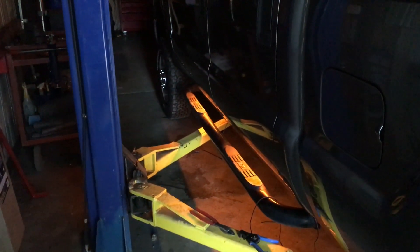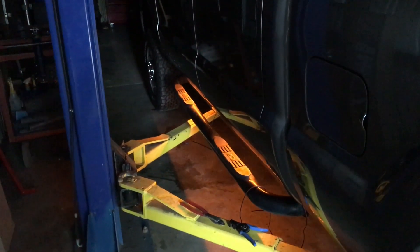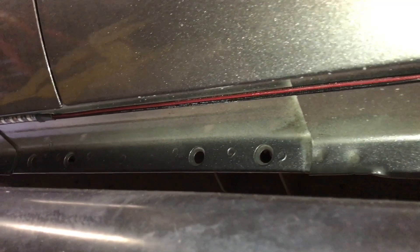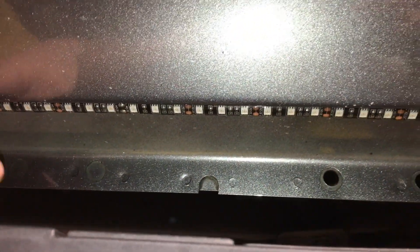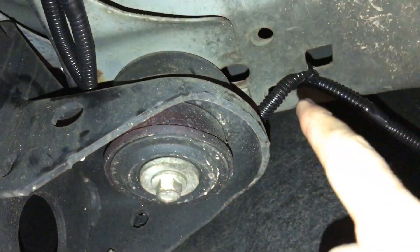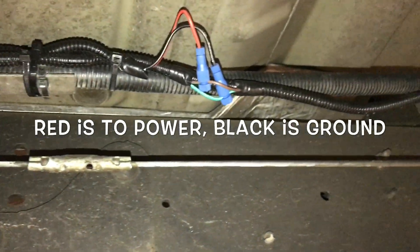There's a little back piece that you peel off and they're on there. Here is how I installed the LED strips — they have that 3M tape on the back, good stuff. I just ran them up under there. It's got a little splice in there which adds a little separation — I liked the look of the two separate LEDs. I have the wiring running inside the fender well, zip tied behind the cab support. I just tapped into these with two posi-locks and we're good to go.